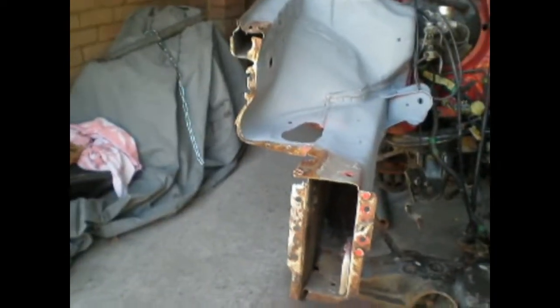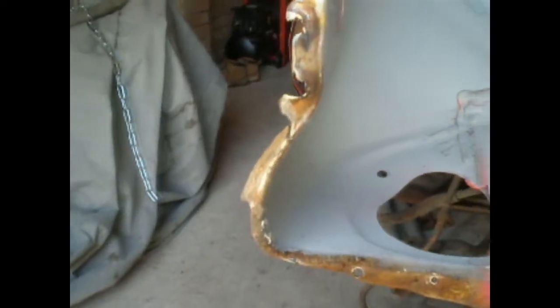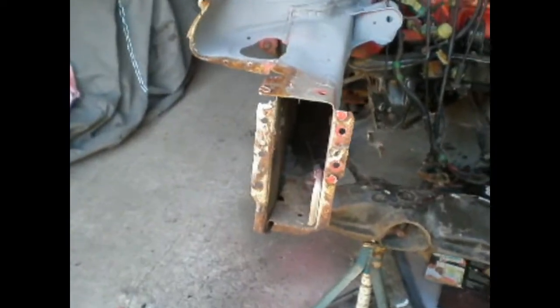We've learned a lot from this side though and I think we're going to be able to do the other side a bit easier. There's a bit of stuff that needs cleaning up here — we might have to put a few new little panels in just to cover up some of the damage. It's just where it's been rusty and where we've done it with the grinder a little bit — we've bent it and it all comes away. We'll tidy that up, get rid of all this surface rust and then put the new panel on.